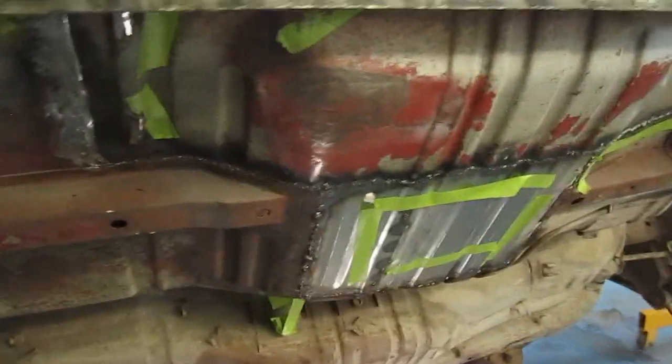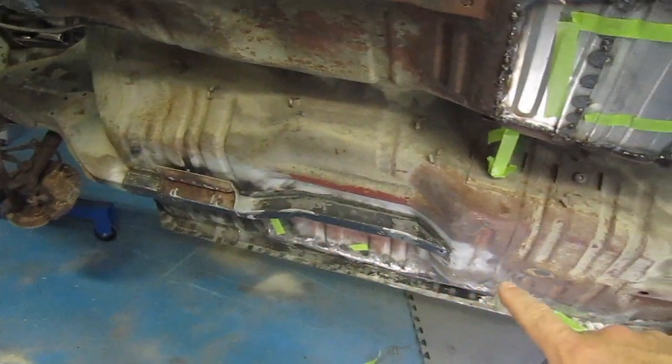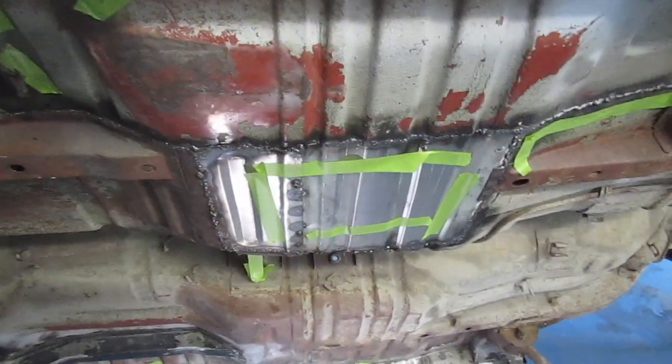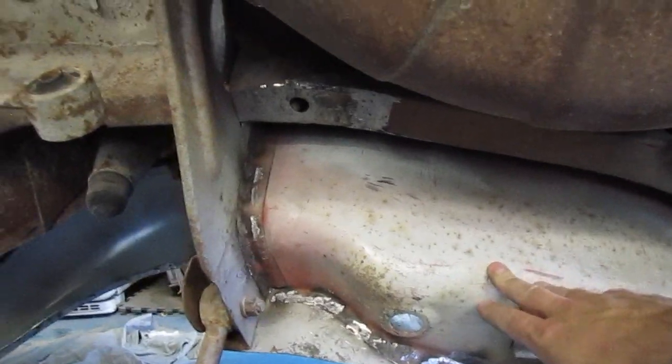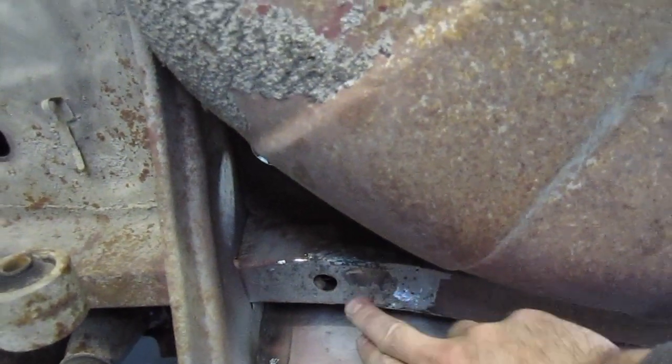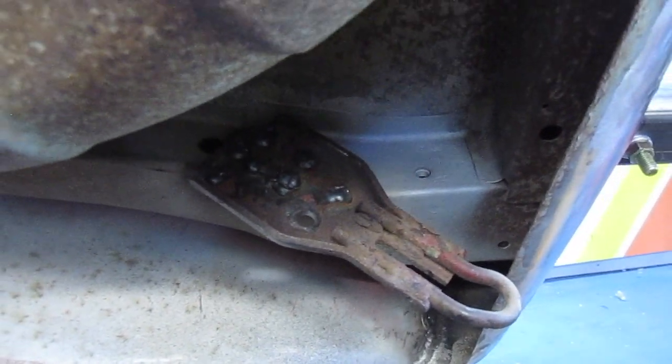What I want to tackle now is grinding these welds down. I had done that on my back flat on the ground — not much fun. This is a lot more productive and easier with less headaches. You can see on the wheel tub where I welded that seam, and in the back corners these were rebuilt from scratch — they were full of holes. This piece is out of another car. I also had to do a couple of patches in the frame rails because of a hitch and some rust. I've also welded on the tow hook from a Miata — the extra one I had — because it used to come up through the bumper in the back.